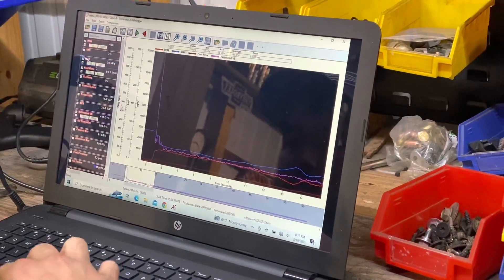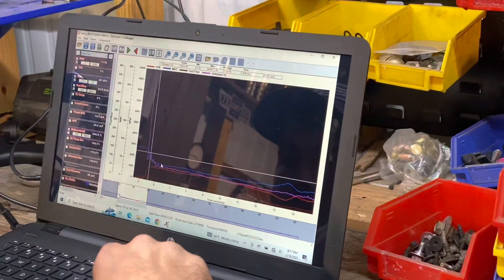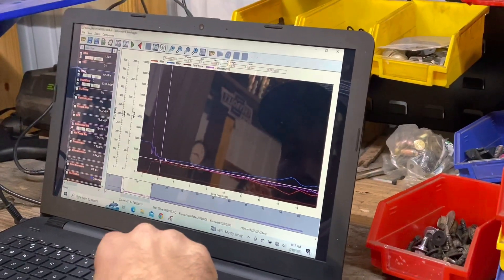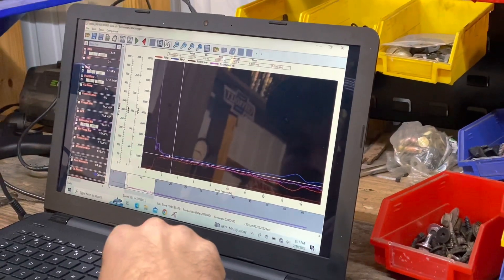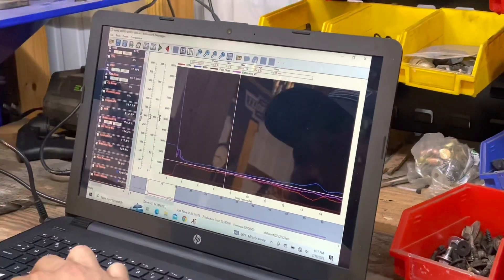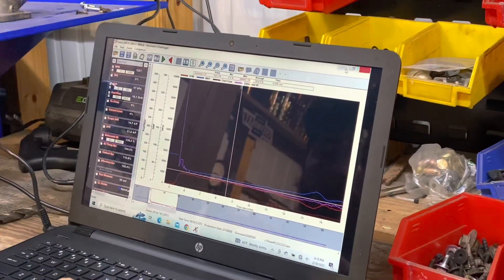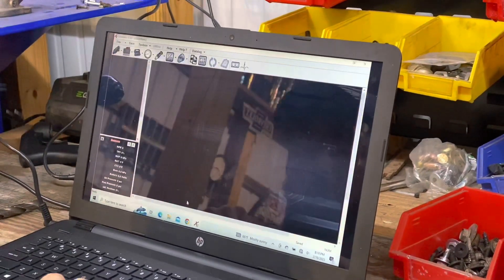This is your VE. Your fuel went up to 400% — like the VE table is at 400%. That's not right. Then we're at 250. We're at 130 at idle. We'll have to back the fuel table way down. We're just dumping too much fuel in it. Would that make sense though — too much fuel making it do that? Might be the issue.